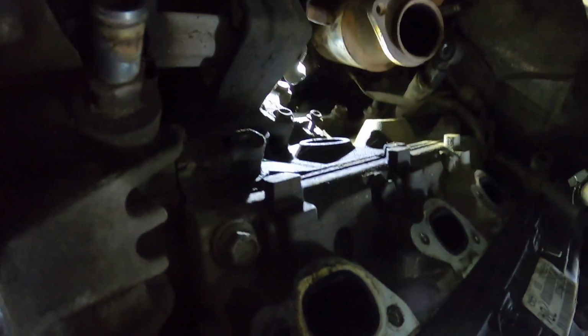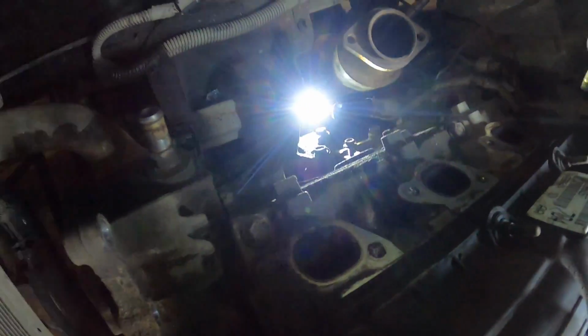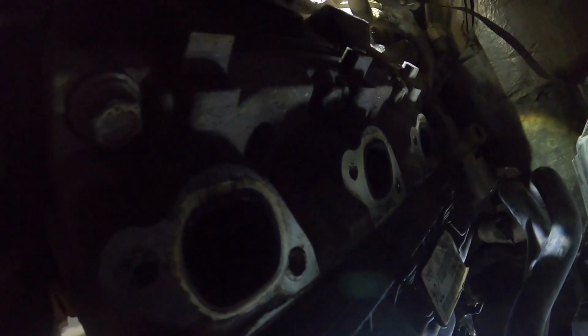This bolt right here is too long, showing into the other side. There and there. Okay. This bolt right here for the motor mount's too long. It's going to hit the cat. It's just way too long, and there's no way of moving this cat back and forth to get that bolt out, is what I see so far. So I'm taking this off next, and then the motor mounts and the transmission. Are we good? Okay.